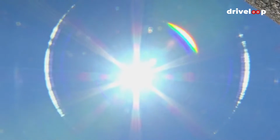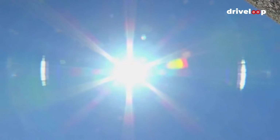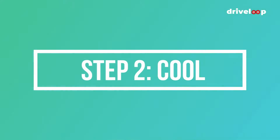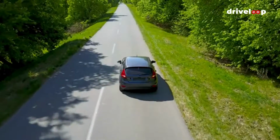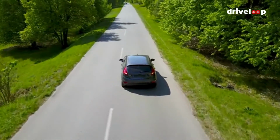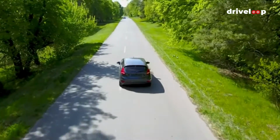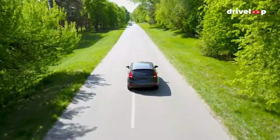Ideally, pick a warm day. Warmer weather, especially low humidity with some wind, will help dry the engine and components after cleaning. If the car was running, flip the hood up and allow the engine to cool for at least 15 minutes. Hot engine components can not only burn you, but they can also be damaged by rapid contraction if sprayed with cool water.